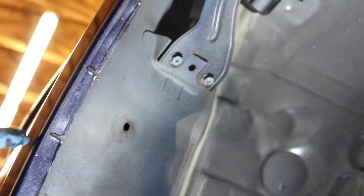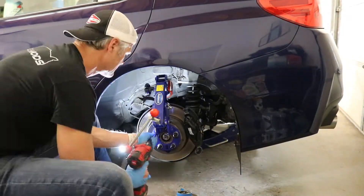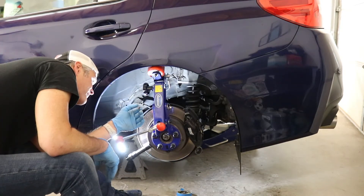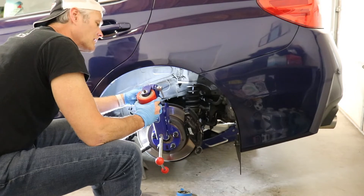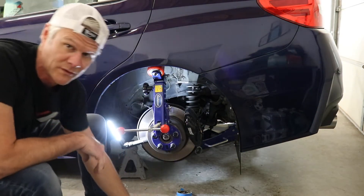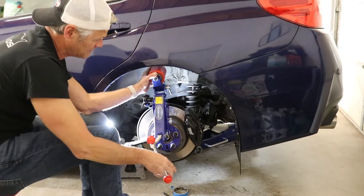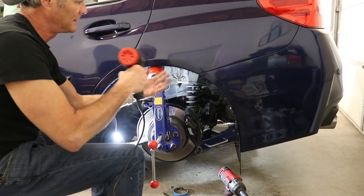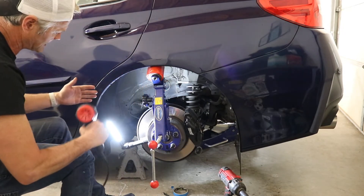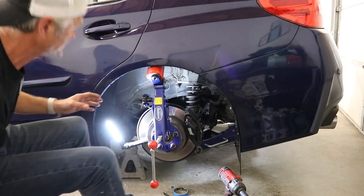You can see where we've got our normal inner flange, and then here we start to cut it away, and we've got relief slits along the way here to help as we apply the heat and start to roll that. Let's look at the Eastwood manual and see if there's a way to get that sucker lower. There is a lower setting, so that's where we're moving it to right now. There we go — now we're looking better. First we'll apply a little bit of heat. These guns get pretty hot so I'm going to keep it pretty far away — don't want to burn the paint. I'll check it with my hand as I go.